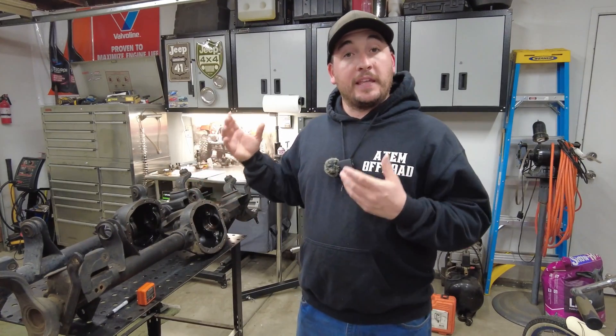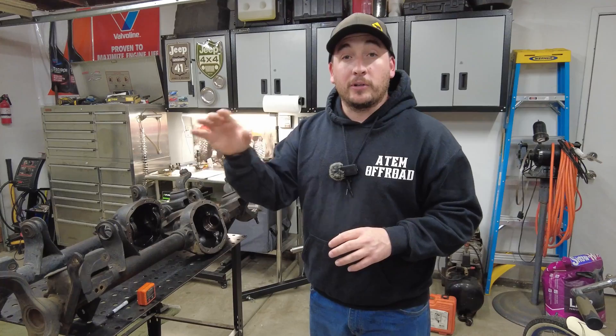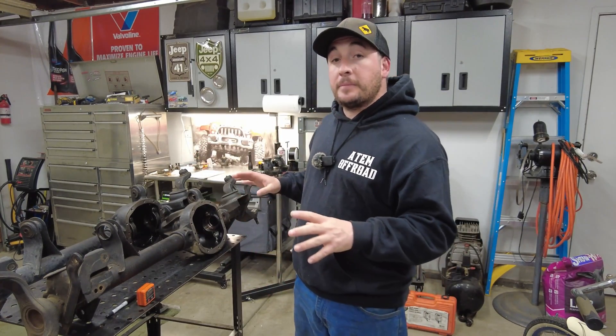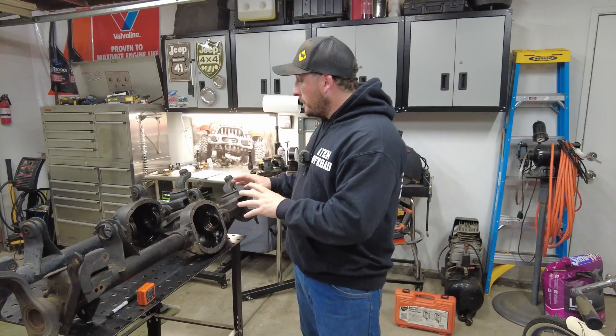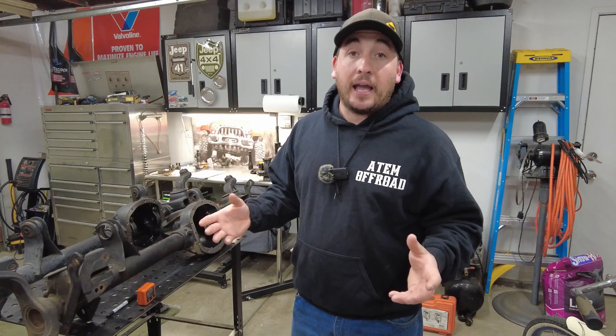So those are the advantages of the HP Dana 30. On paper, if you're going to build a Dana 30, you might as well spend a little more money and acquire the HP30. It's going to solve some problems underneath the Jeep — it's high clearance, better lubrication, better caster. All of that is going to be an improvement, especially with the improved internal design. It's just overall a better axle to spend your money on if you're going to be building a 30. I'm super excited to move on to the next video, where we're going to be stiffening up this axle with axle sleeves, trusses, brackets, and things like that, and ultimately re-gearing it to build the ultimate Dana 30.